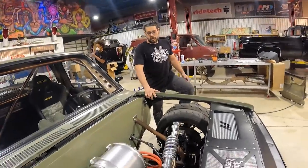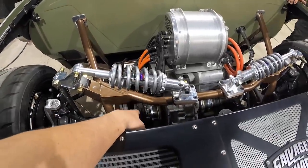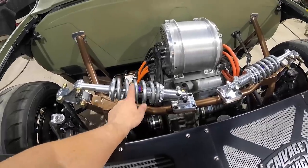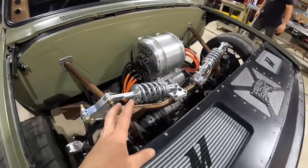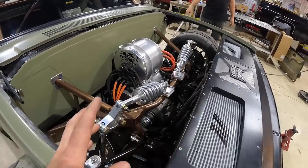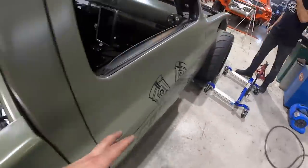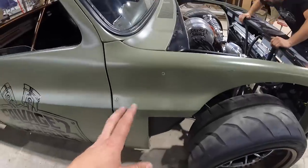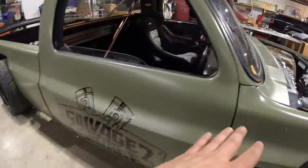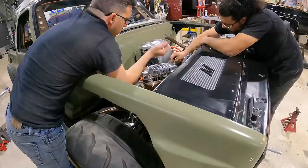We are on the ground and the push rod suspension is push-rod-ing! Andrew says it's looking great and seems to be functioning well. What we were looking for when we dropped the front and back end was our actual spring compression — right now we're not killing these springs. How stiff the ride is will be determined once we actually drive it. In the back we have some rebound we can dial in. What we're looking for is four inches of clearance on all four corners on the battery pack, because we don't want it too low — otherwise the battery pack bottoms out. The bottom of this truck is completely flat, so if it bottoms out you lose traction on all four tires and it'll almost hydroplane.